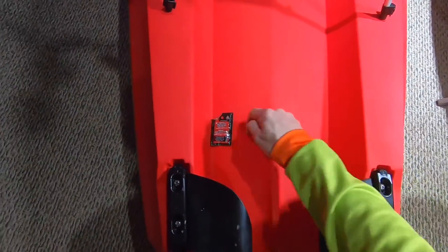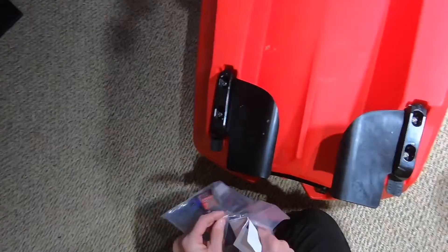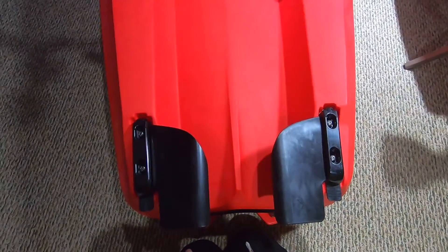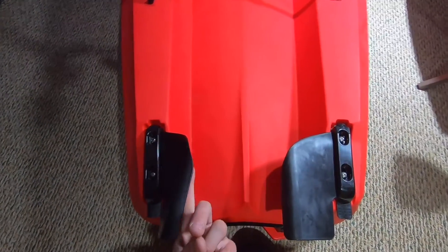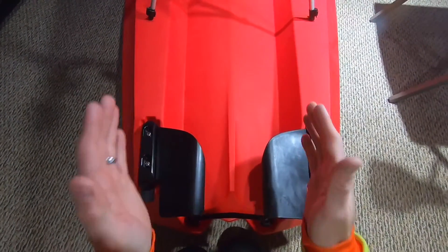That's it. Stuff makes a mess — I'll wipe this crap off. So that's pretty much it, that's an easy install. You don't have to use the Never Seize, it's up to you — I'm just doing it as a precaution. So this should work pretty good now. The purpose of these flex wings is to keep the stern of the boat straight. If it starts kicking out, these wings are going to catch the water and act like a rudder. That's the whole purpose — to keep this boat true and straight in the water.